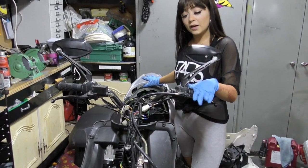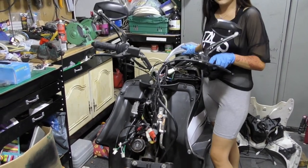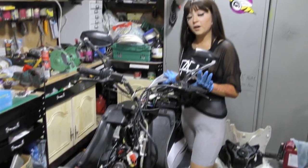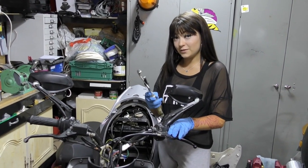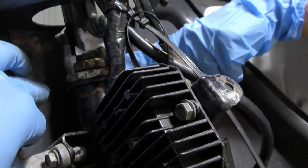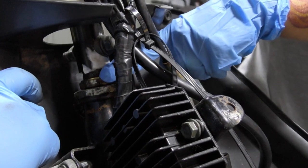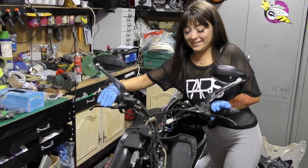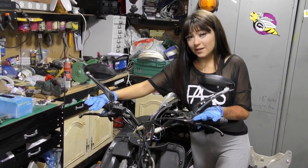More bloody cable ties. Right, let's see if we can tighten it down. Remember, when tightening the headstock, don't overdo it - you've still got to be able to move the handlebars like this, otherwise it just won't pass the MOT. Amazingly, I've tightened the headstock down. Luckily, this is double nutted, which means I've tightened this bolt down and now I can tighten this one to lock it. And now it's not doing it like it was. It looks like it has tightened it down.